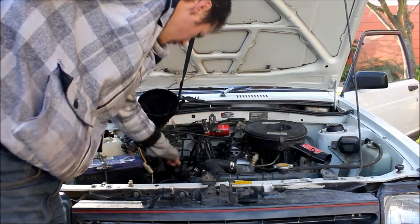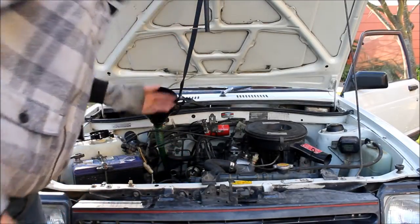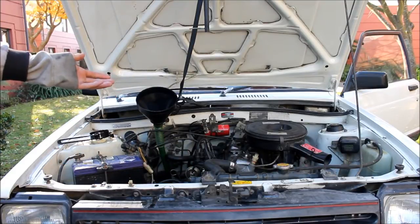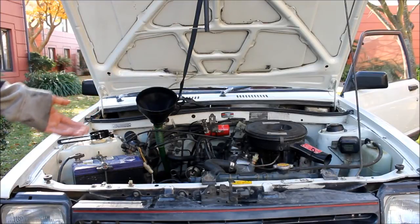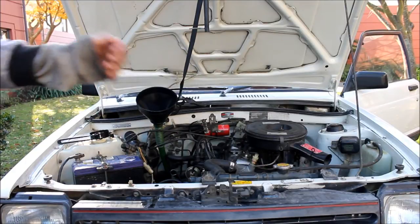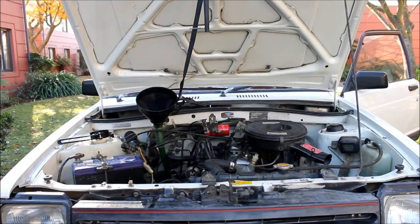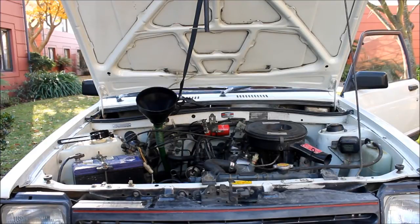I had to add a bit more oil to the engine — it was about a millimetre below the full line. The gearbox holds 2.5 litres of oil and the engine holds about 3.2 litres — that's roughly 2.6 and 3.5 quarts. It's pretty much a complete service and the engine should run quite well now. I'll keep you guys updated on whether the synchronisers have stopped being notchy at low temperatures. You just don't want modern GL5 spec oil as it's too slippery for these gearboxes when they need a bit of grip for the synchronisers to work in the cold.